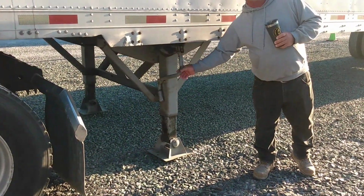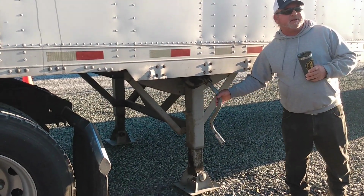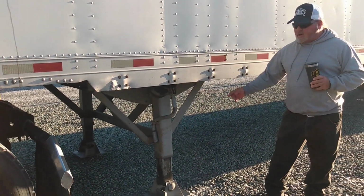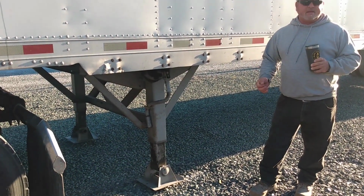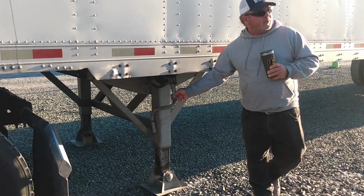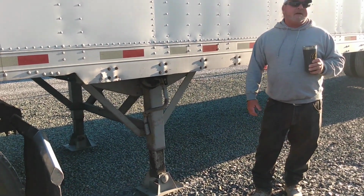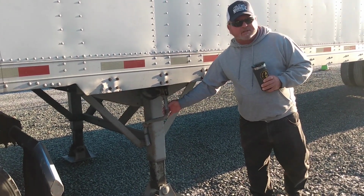All right. This thing's doing this going down the road. Almost guaranteed visit from the man with the blue light. Always hang that thing up. If they don't have somewhere like that to hang it, as long as it's secured, it don't matter if it's a bungee cord or a shoestring. As long as it's not flopping around, you're good. You don't want it to cut loose and go through the windshield of a minivan. You don't want to get 2 hours from the Canadian line and 6 hours from a Napa store and not be able to drop your trailer when you get there because you ain't got no handle. Always take care of these things.